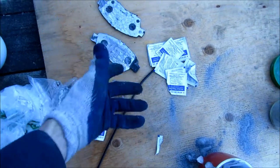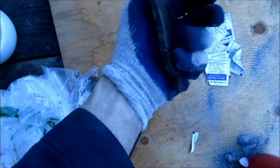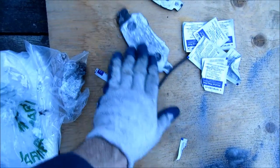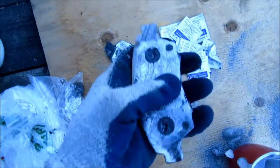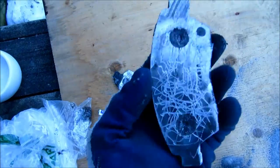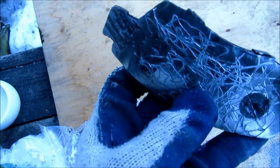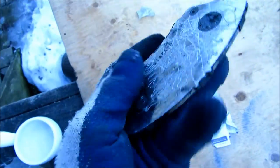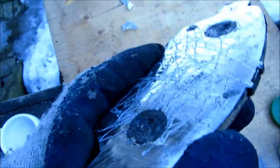So I opened it up, took the wheel off, opened it up and took out the brake pads. I ground off any remaining sign of brake pad that was on there. I used a grinder with a sandpaper flap disc to give it a pretty nice looking finish, and then I used a Dremel with a steel grinding bit to just rub up the surface a bit.